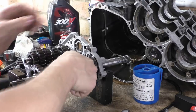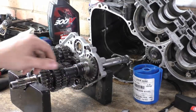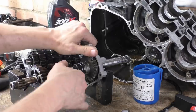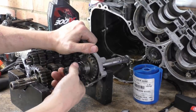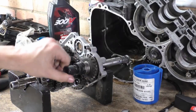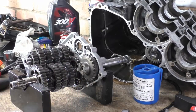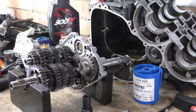And then all of a sudden now you have the opposite side of your shaft, but this ring clip will break off under massive torque. It'll basically just force it off. If this just starts to go like that, or like that, if it wobbles out like that, this shaft goes all over the place. This clip has now come off and now you're flapping around, and then more torque will just make the whole thing pop clean off like that. So this is a sacrificial part, so you don't wreck your entire cases.